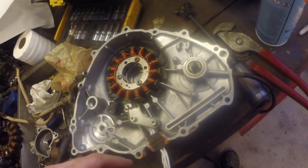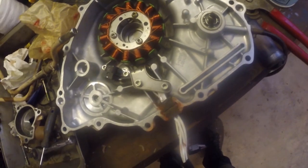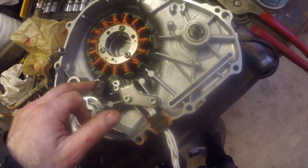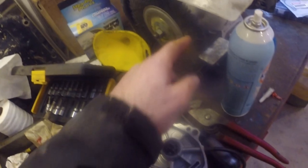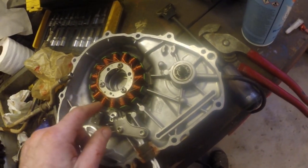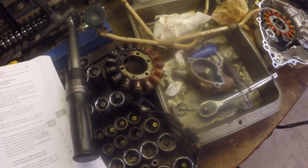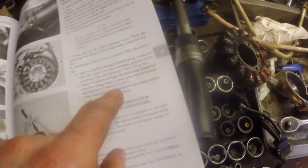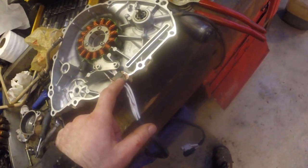Clean all of this whole housing with contact cleaner or brake cleaner and then blow it dry. That includes any of these little passages and the places where the dowels will go - you want those clean so the dowels fit in there nicely. Also use contact cleaner in each of the bolt holes to clean any residue out of there. Then clean all the bolts on a wire wheel on a bench grinder. Use medium strength thread locker as described in the manual to coat the threads of the bolt - only the threads that will be immersed in the case. Tighten the whole thing to 62 inch pounds, which is seven Newton meters. Use a torque wrench.